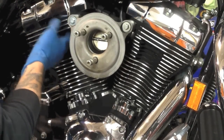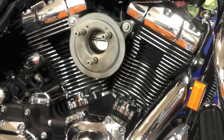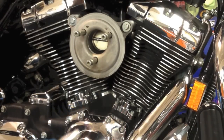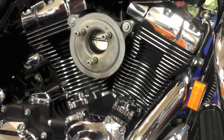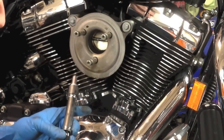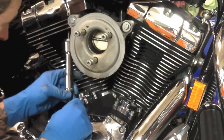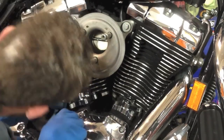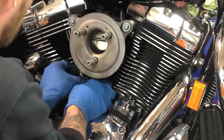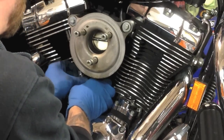New o-rings in the heads, new o-rings in the push rod tubes, new o-rings in the bottom. While I'm sticking my fingers in there, you're going to want to check your push rods — your intakes are shorter than your exhaust. I usually mark mine, and then I mark them down here with dots so I know how many turns out I'm doing. These are three to four turns. Different push rods have different thread pitches, so make sure you check. Do this with the motor cold.